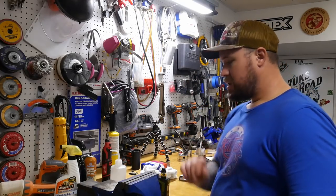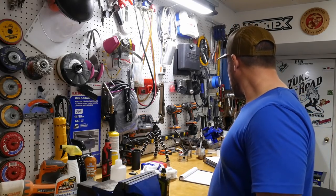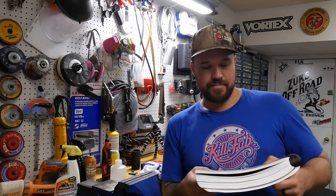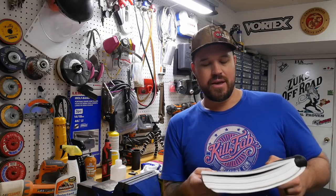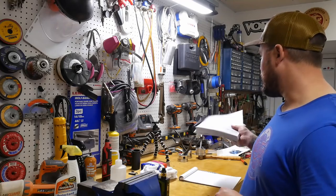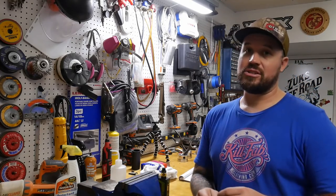All right, y'all, I've made an executive decision. I'm going to change my range just because it doesn't do any good to not show you how to actually properly adjust your ring gap. I'm not going to go all the way to the limit. The limit is 0.0275. I'm going to go to 0.02. That's what I'm going to file the rings to.